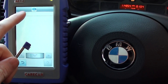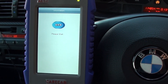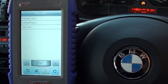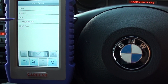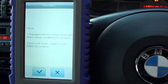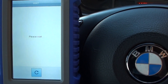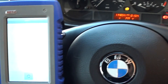We're using a touchscreen here — you can use your fingers to scroll through the actual menus if you want to. So we're just waiting for the kit to connect to the BMW module. We'll click on 'manually select', then 3 Series, E46, click on chassis, ABS anti-lock brake. It's going to click 16-pin socket and give us the option to diagnose faults or read fault codes from the ABS system in this BMW.